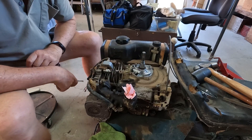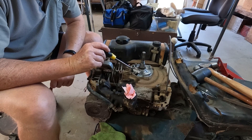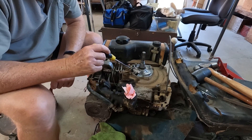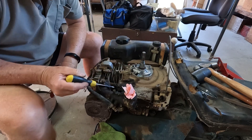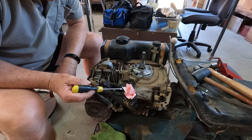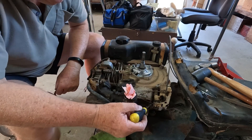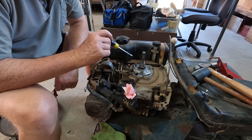While we're here I'm going to clean these wires off. You can see there are two wires that attach — one comes into the coil, the other comes out which is the kill switch. That looks pretty ordinary through here. I'm not sure if the wires are earthing — if they are, we won't get a spark. We'll have a look at that and make sure it's all okay. This looks pretty clean and good inside.